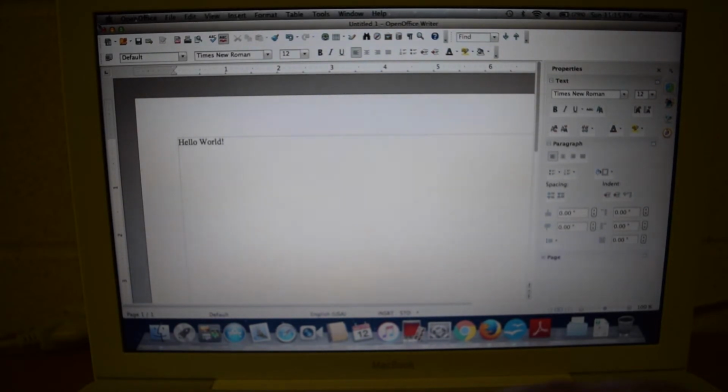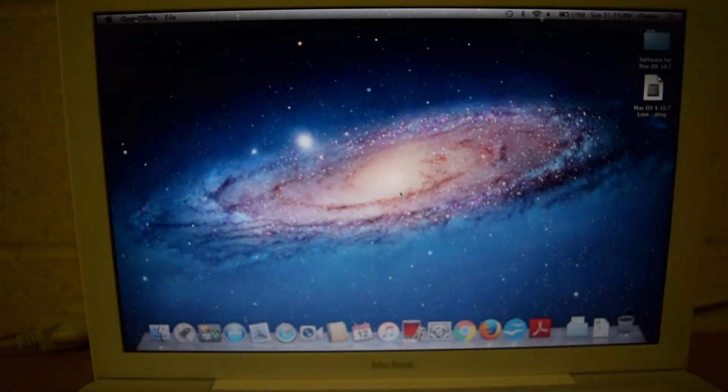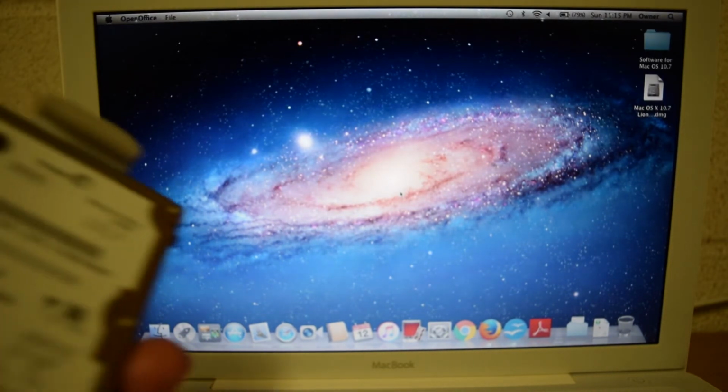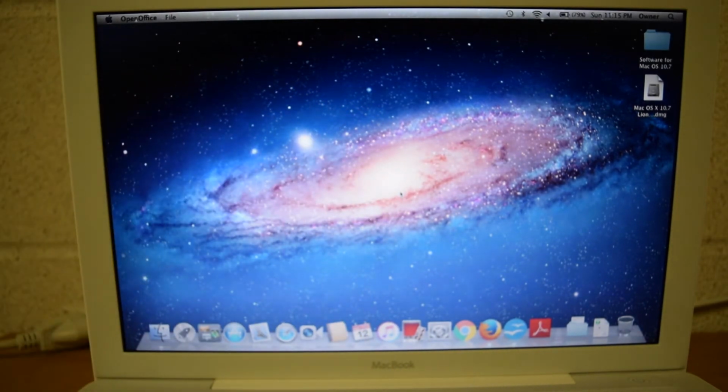Now, if you are going to be buying one of these machines, you should definitely understand that there are limitations. It's not going to be an instant boot up. Like you saw there, it took just under a minute to actually boot up. Part of the reason for this, besides having older, slower RAM and an older, slower processor, is that these are going to be using, like I showed, these traditional style hard drives that in most cases are going to be operating at SATA 1 speeds, which is 1.5 gigabits per second, which sounds good, but comparatively to the SSDs we have today, or even the 7200 RPM SATA 3 hard drives, is fairly slow in comparison. So if you are going to buy one of these, just be aware that they're not a speed demon. Really, you have to understand that there are limitations.